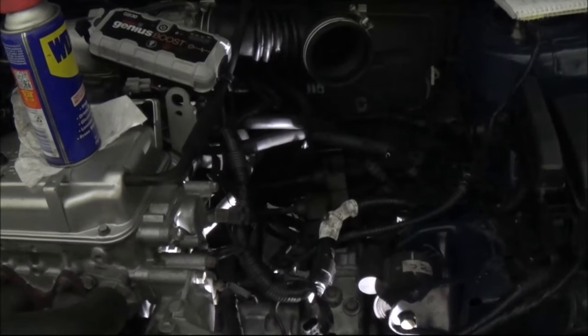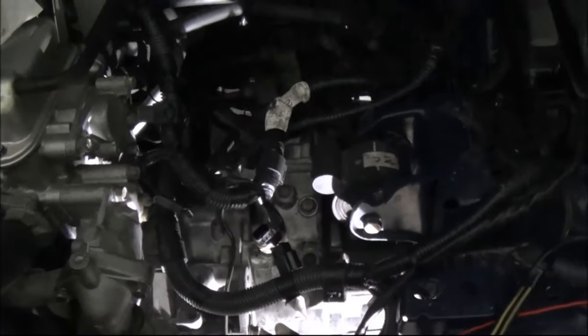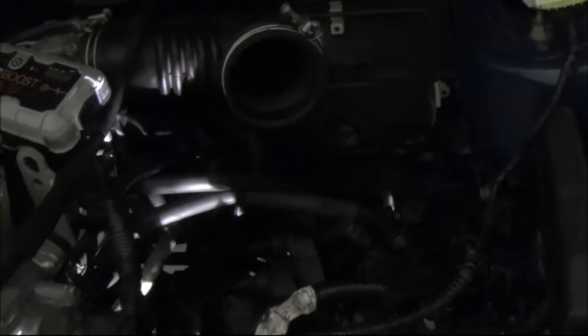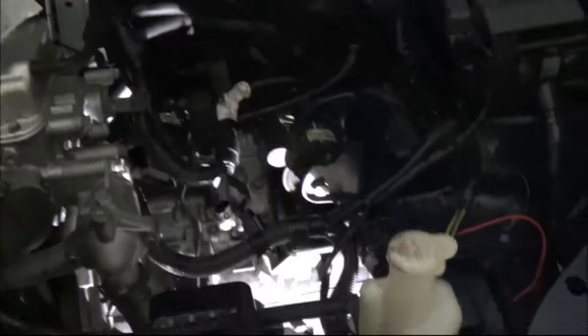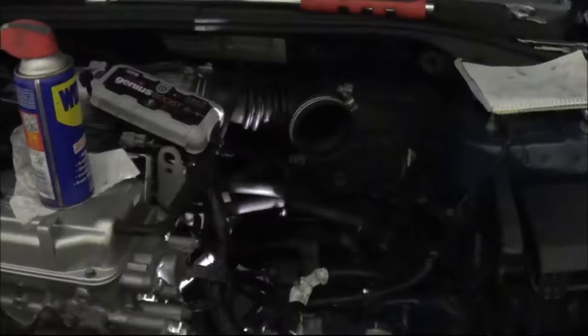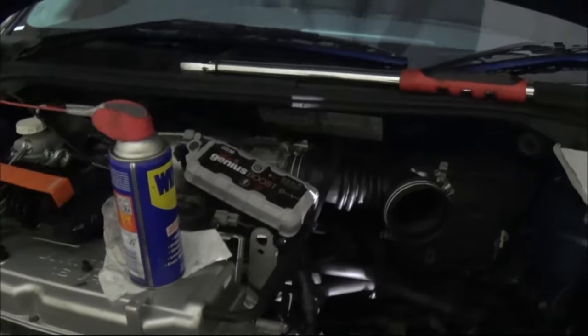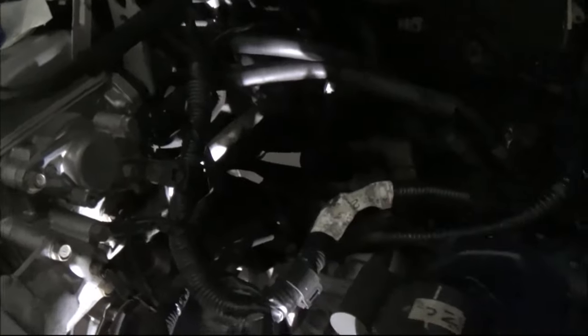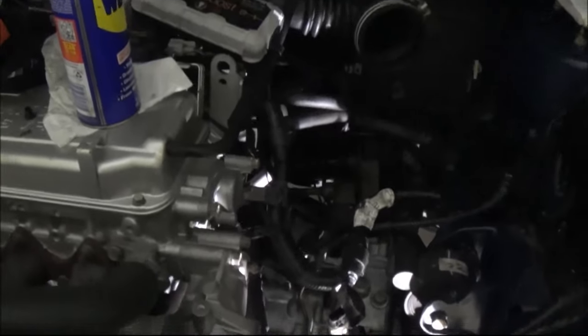Once you install the clutch, the biggest challenge is to align the gearbox on the spline. After a little wiggling you can do that, but the biggest problem is to match up the bolts where the transmission mounts are. That's the hardest challenge. I was struggling with two heavy duty jacks to level up the car and then jack up the transmission up to the engine level, and then lower the car with both jacks supporting from either side.